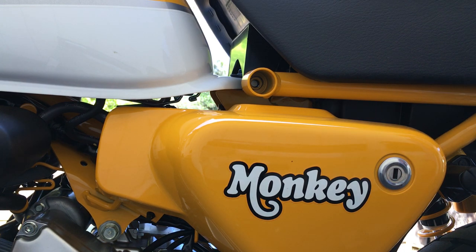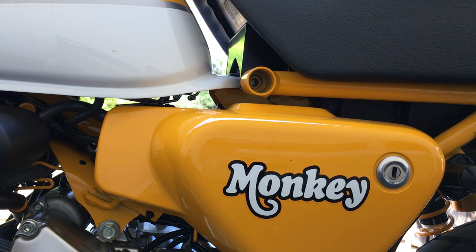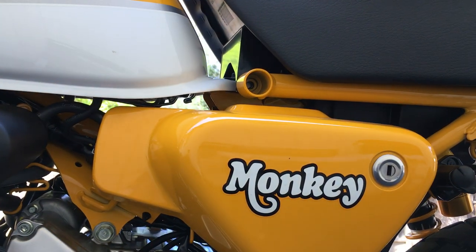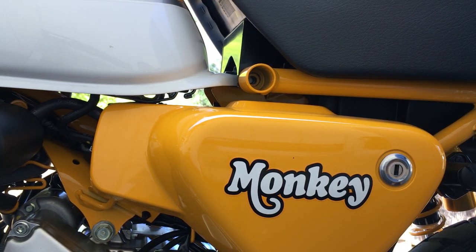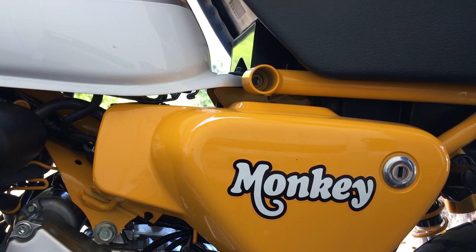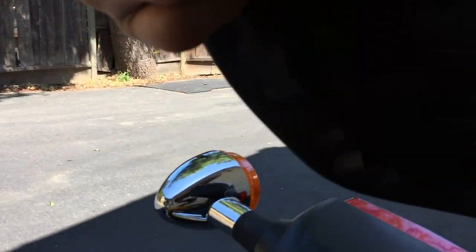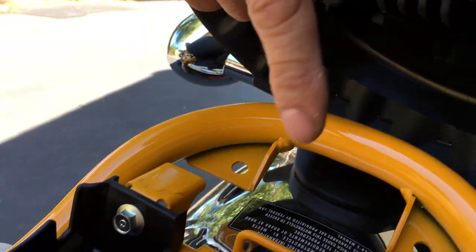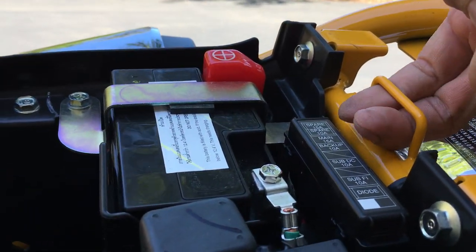Let's see what else I'm gonna do. I need to slide it forward. That bolt's in the way. Let me tilt the bike to the brake side. Get that bolt out. Now I need to push the seat back. Then it comes off. Why push the seat back? Because the seat has this hook over here - see this little thing here? It's a hook, and that hooks onto this wire right here. It hooks underneath like so, and that's how it holds.